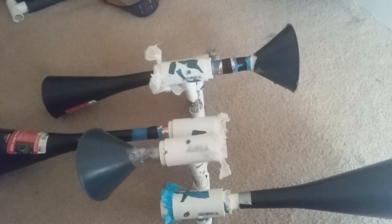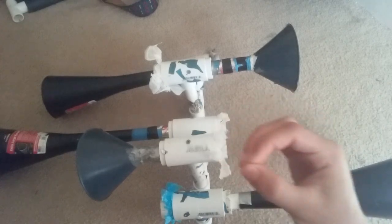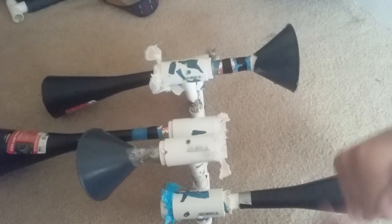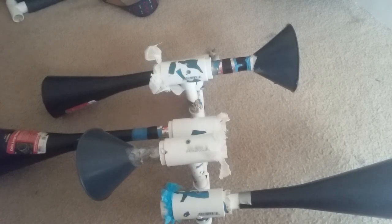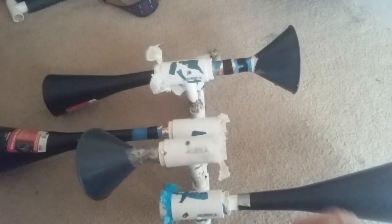The reason why 6920's horns sound so bad is that not only is it fully orificed, but it is not restricted. Solenoid valves deliver air at a very high level very quickly — it's like punching the diaphragm very quickly. It will sound okay after about a week or two, but since the 37 bell, which faces forward, has a tendency to lag, you won't hear the 37 bell. I'll leave a link in the description labeled as number one.